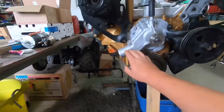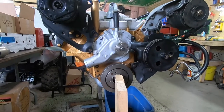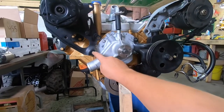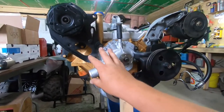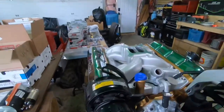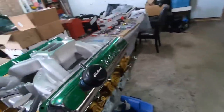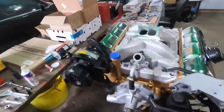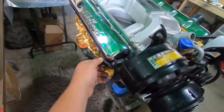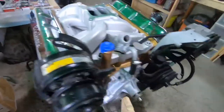The AC bracket is just one inch shy because of the one inch deck height difference on the 455, so we're gonna need to build out some brackets to get that all situated. And up on top, the stud for the head bolt is on the wrong side, so we're gonna need to swap out this one head bolt as well as modify this bracket so we can get our valve cover on and off without a bunch of hassle every single time.